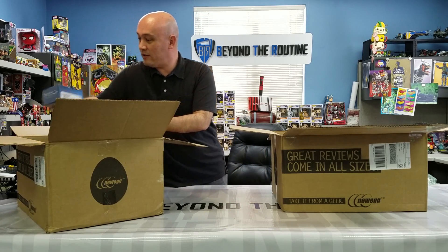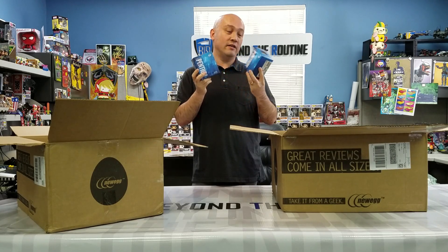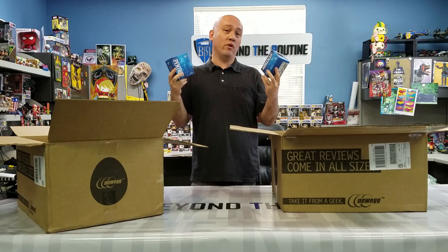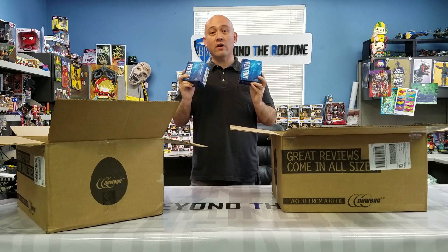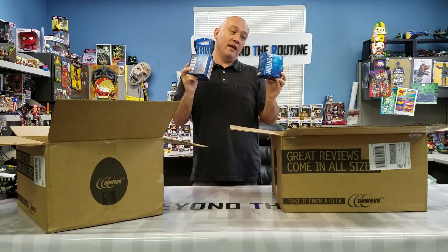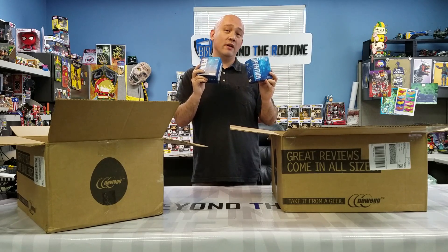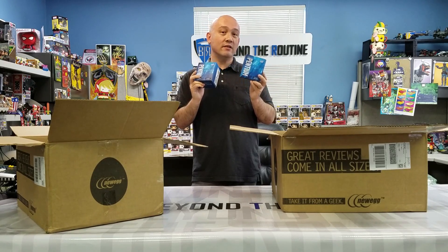We got our CPU, and we went with the latest generation Kabylake Intel Pentium. You could have gone with the Celeron as well — basically the lower the wattage consumption, the better, because the CPU isn't really going to be working hard. Max 1-2%, pretty much idling the whole time it's mining, because it's mainly the video card doing all the work. But we went with the slightly better G4560 in case we ever want to do anything else with these rigs. These CPUs are dual-core with hyperthreading, unlike the Celeron that doesn't have hyperthreading, so it gives you four cores total and can actually do decent gaming tasks.